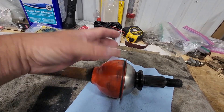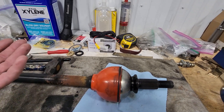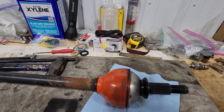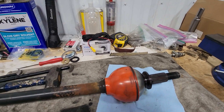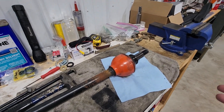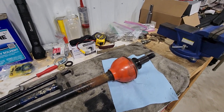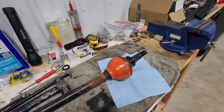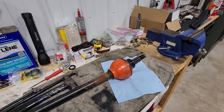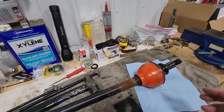Inside the bell between the inner and outer shaft is a CV joint, which is composed of an inner and outer cage and ball bearings, and they will wear out over time. Mine had about 40,000 miles on them. For most people, even with regular servicing, it seems to be that 40 to 50 thousand miles is about what you're going to get before the joints start to wear out.